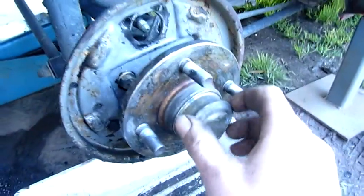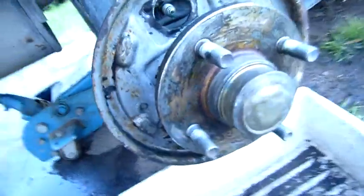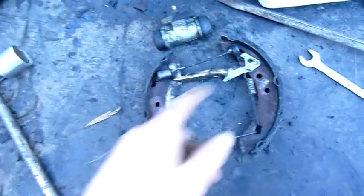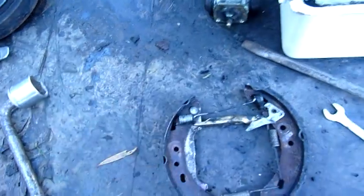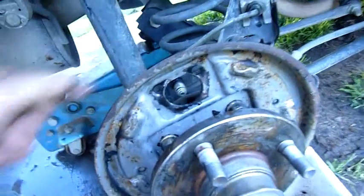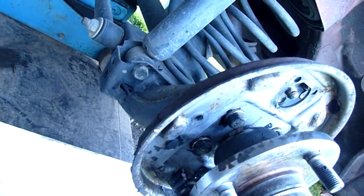I'm getting cleaned up. I never did get that nut off the spindle — it is very, very tight. It's not too hard to do with the hub still on there, so I'm just going to clean up the backing plate and give it a bit of a paint. That's how the shoe assembly sits inside it. I took it apart piece by piece — there's a little tensioner thing for the parking brake preload with a jack screw in it. That's the dead, leaky cylinder — so I've got to replace that one. And both shoes, but I've got to clean up and salvage all of these other little bits. I'm just leaking fluid down from the reservoir at the moment, so not bad. I'm going to purge the crap out of the system anyway — do a full flush and bleed. But I'm going to have to wash most of that fluid off before I can paint it.